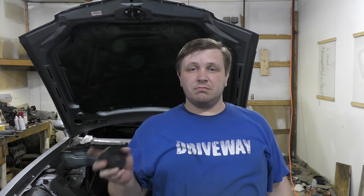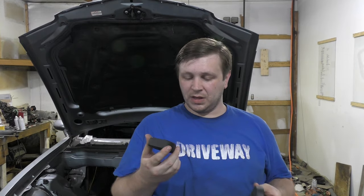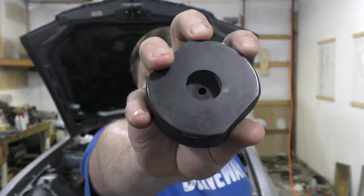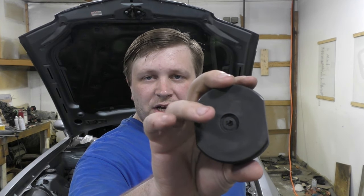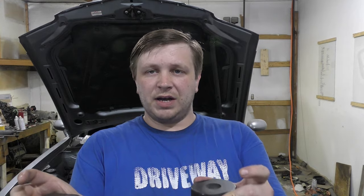Enter the hockey puck. Now if you've watched and subscribed to my videos you'll probably have already seen this, but for those that haven't: we take some hockey pucks, and depending on the size of your radiator you cut down the sides, then countersink a hole to run a bolt and a washer. For the nutserts that I'm using, I countersunk the other side so this allows us to bolt this to our bottom radiator support.